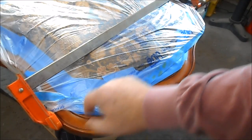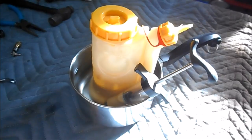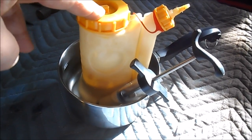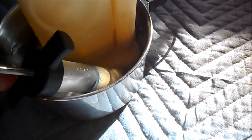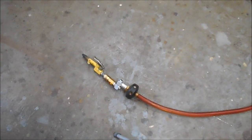I've got that tape right up to the upholstery — I don't need any glue or dye on it. It's about 40 degrees here and the glue has been stored in the shop overnight, so I took it inside, boiled some water, and sat the bottle in there to warm the glue up to around 100 degrees — that helps it flow better. After viewer comments suggesting a glue injector, I bought one, loaded it with glue, and it's sitting in warm water to stay nice and warm. I've also got dental floss ready to try that technique.